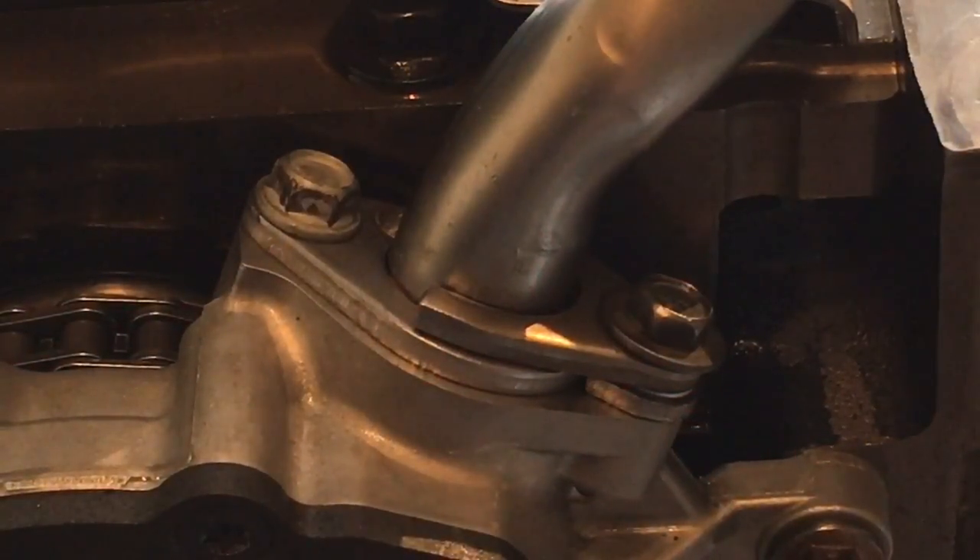Here's the finished product. We'll just call it the ad-libbed pickup tube brace, made by using the crow's foot that you create off of a piece of an oil pump pickup tube you could cut that off of. I will admit, I had to use a longer bolt than the factory hold down bolt for the pickup tube, which I just happened to have in my hoard of LS bolts. I searched through until I found one that was slightly longer, to take up the difference of the spacer and fully engage the threads.